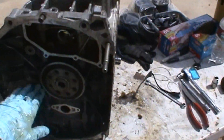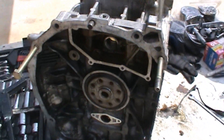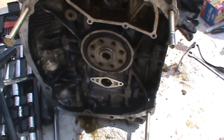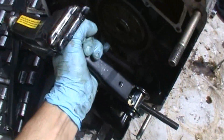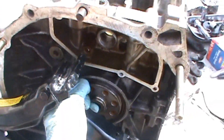Now the tricky part is to get the block to split in half. One half comes up this way, the other half comes the other way, and then you can get access to the crank and the rods. A pretty easy method — the only one I've ever used — is you take a cheap car jack and put it in between the bell housing. Stand it on one side and lift it all the way up to the top of the bell housing and it should slowly split it apart.